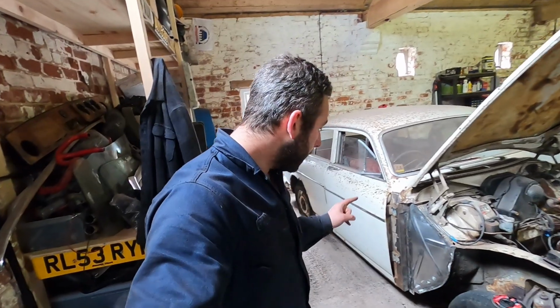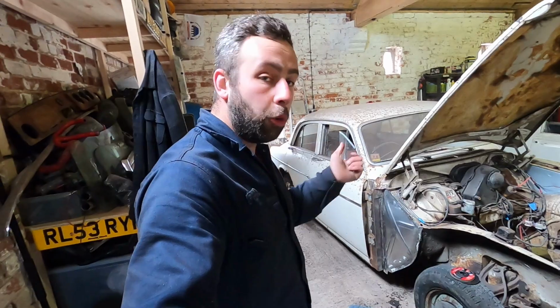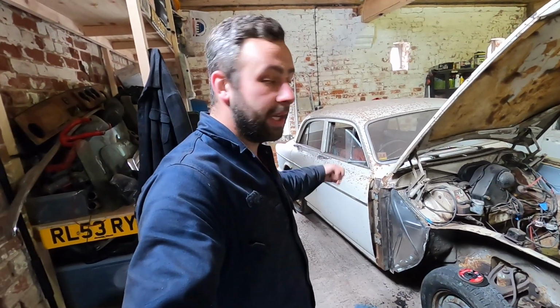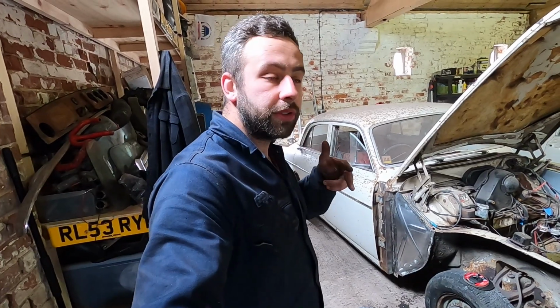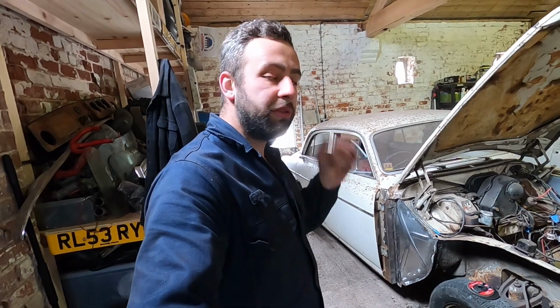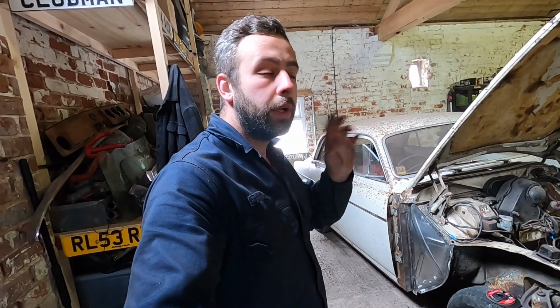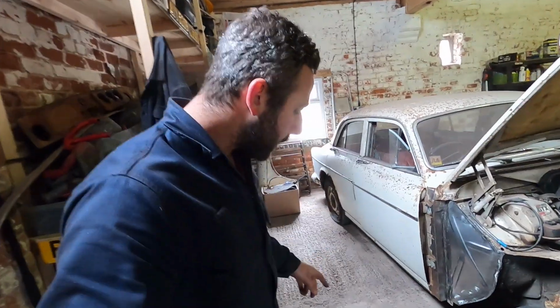So, you've just seen me then, just finishing off. I've just taken the bonnet pull tab off the old bit of panel, and now we're going to just reach in and stitch weld that to this new panel. On the A post, I've put little arrows where it should be, but obviously we have that internal trim panel, which we can then just test fit to make sure it pokes out the right hole of that panel. So we'll sort that out now, but I'll just show you it here.